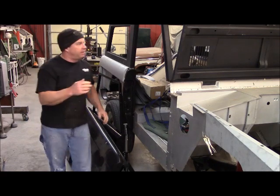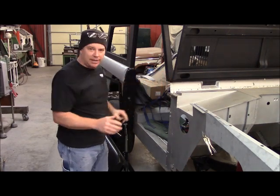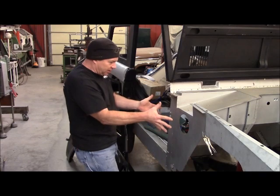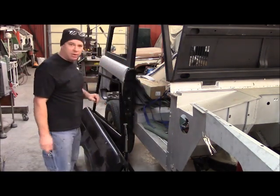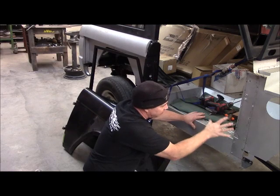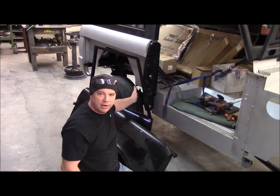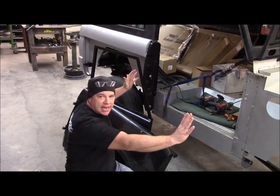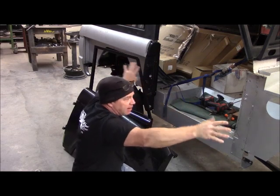My window frame was a little off right here — I need to pull this back a little bit, and that's going to tell me the location and height of all that. That's going to raise my hood a little bit; as it comes back it's going to do a lot of good things, and it's telling me I'm on the right path. I'm going to look at this, take some screws out and turn this post just a little bit until it's just perfect. Then I'll raise this fender up and that's going to give me the location of my hood. After studying this a minute, I think I've got a sweet path — this post doesn't need to lean back, it's perfectly level. It just needs to come back about five millimeters, and that's going to fix my door gap where this rear door opening landing is.